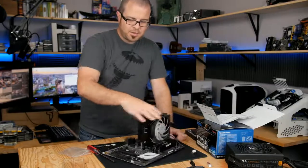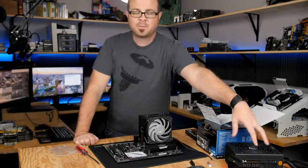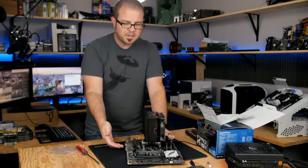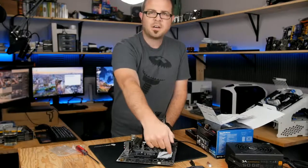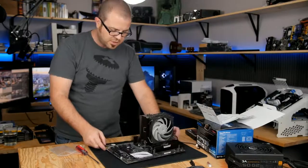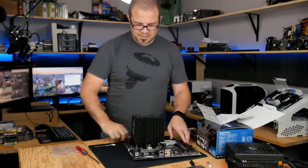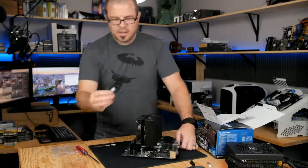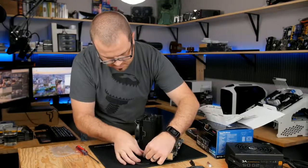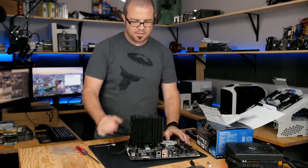Our motherboard is now prepped — we have pretty much everything installed. Here's where, if I wanted to do an outside-the-box build, I would take the power supply, connect my 24-pin and my 8-pin, connect the monitor, and then short the on/off pins on the motherboard to turn on the system — or sometimes the motherboard has an on/off switch built onto it, though this one doesn't because it's on the more budget side. I'm going to plug in the CPU fan now since it's out here — there's a 3-pin fan header that says 'CPU fan' on it.